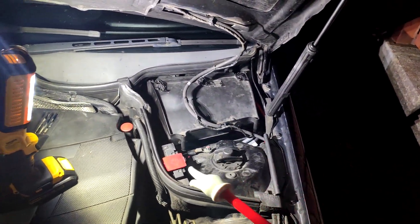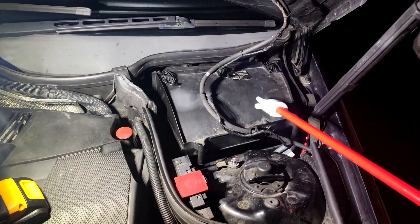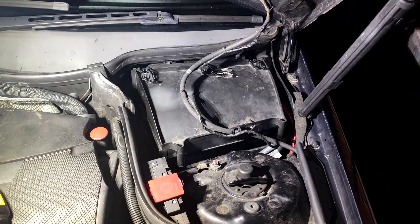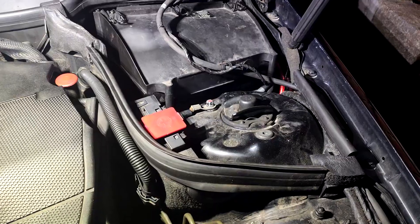Basically it'll keep the car powered continuously whilst you change your battery, so as you take this out and your battery is disconnected, you're still getting power from these two to your battery sitting there on your jump leads. That's supposedly Mercedes best practice, but I've not seen anybody do that.